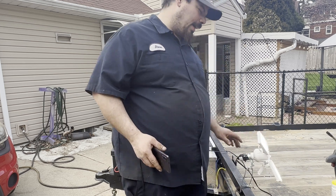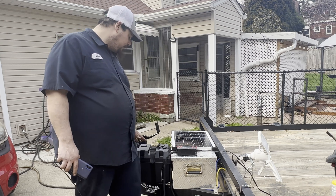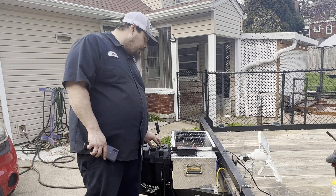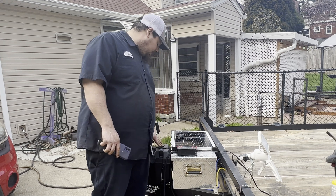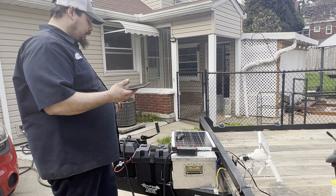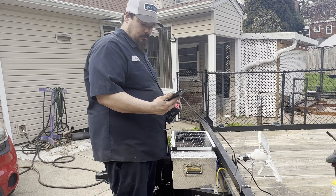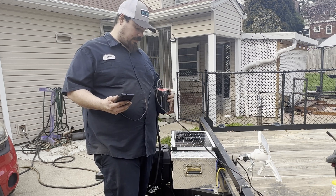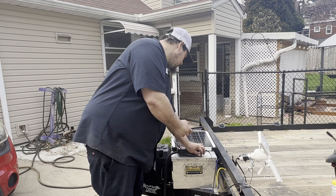Tomorrow I'll come home and check to make sure this voltage meter is reading charged. It says 12.2 right now - that's with a load on it. Let's take the load off - it immediately bounces to 12.5 volts. That's not bad. Also, this inverter has a USB port on it as well, and that USB port actually charges without the unit being turned on - that is a really nice feature. We do have everything ran through a fuse - everything except for the solar panel. That's a real nice solar setup, I would say.